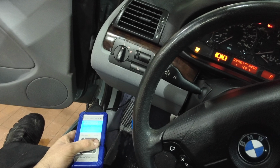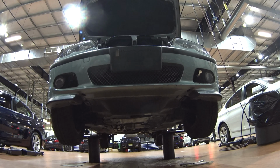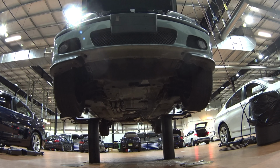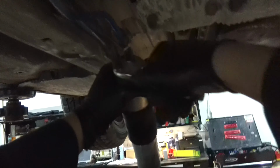But now after the engine has no vacuum leaks, gave the car 2 days of driving, check engine light comes back on. With the same lean mixture fault present again, maybe it wouldn't be a bad idea to change out the 15-year-old fuel filter since the car did a lot of sitting over the years. These lines are like falling on it.